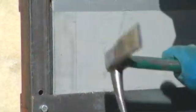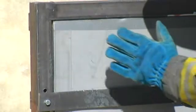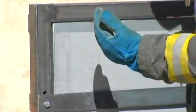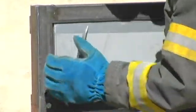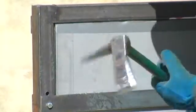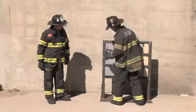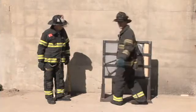What I'm going to do is beat the door about 4 to 5 inches in this area here. Yeah, 4 to 5 inches from the leading edge. Right. What's going to happen is when this front part of the door starts to make its way towards the back end, that edge is normally just going to play over to me a little bit. All I need is a little bit, especially since I have something to hit with to get the tool in. If I just had this, I could do that till the point where I could get this in by myself. But I have that tool with me, so I'm going to hit it enough to give me a little more play and to drive that tool in.